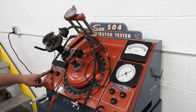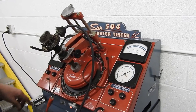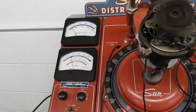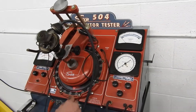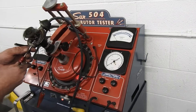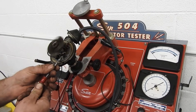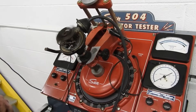I'm going to set the dwell to 8. It's already been calibrated. You'll see here it only has about 16 degrees of dwell — this calls for 30, and the points gap is giant. But while we have it on here we'll adjust the dwell. Now we're right at 30.